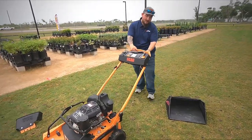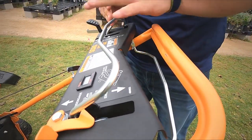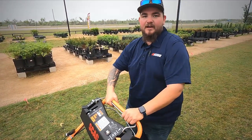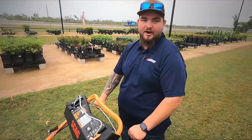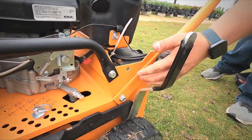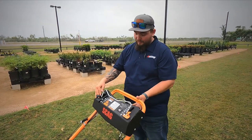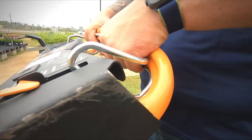The bottom right here — one great thing is if you look in this channel, you can see how it's grooved out. That groove is perfectly aligned for this handle — see how it falls right in there? So when you're using it, it's very ergonomic compared to some of the other ones. I also like the height the handles sit. On our Exmarks they're kind of down by your waist and you're almost pushing down and forward. On this one you've got three adjustments for your handle for different height people — you just loosen this and move it up or back to get it where you want it. It has the same thing when you pull the lower handle up — it also falls right into that groove, so it's real easy to handle.